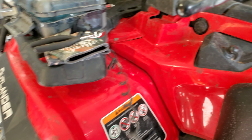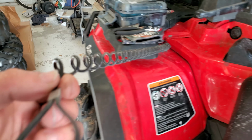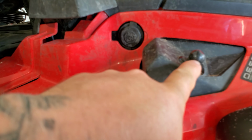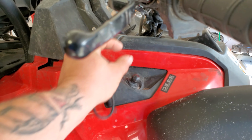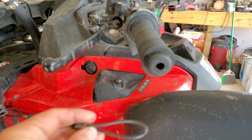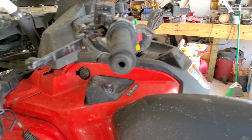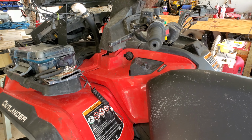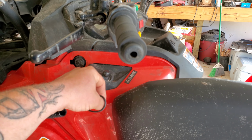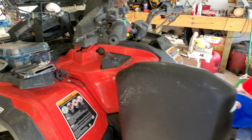And this right here, I got this on Amazon for like $6. It's like a jet ski type deal. You pull the cord and it kills the jet ski. But I put it there because these fancy keys that these new bikes come with, they just clip on. Now, I've seen people actually kill their bike because a tree branch grabbed their lanyard, knocked their key off, they couldn't find it, and the bike went straight down in mid-water wheelie and swamped. And it was actually like a Renegade 1000. So what I do is I just clip the lanyard that's on my key to this. So if it ever does get knocked off, it's just going to go right back where it came from.